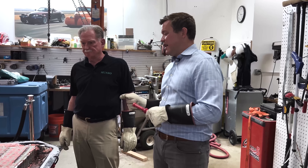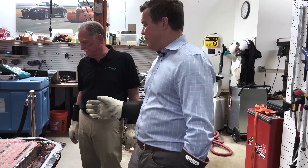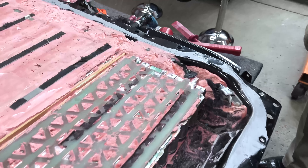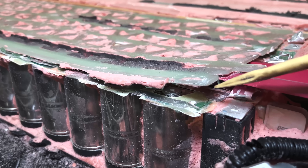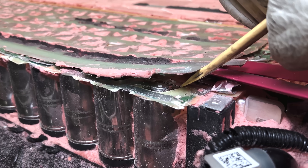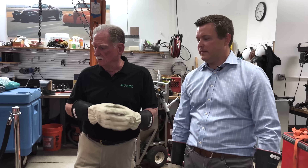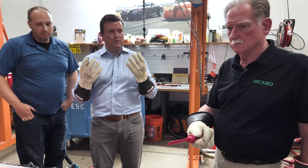To wrap up this video: our team is going to pull up this plate to show you what it looks like underneath. You'll be able to see how the collector plates are connected to the top, and the positive and negative of the cell — the center is positive and the outside of the can is negative. We'll have that B-roll drop in right now, but we didn't want to do it on camera because it's kind of glued itself back together.